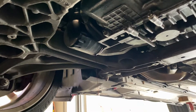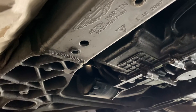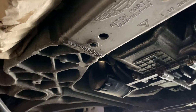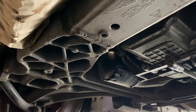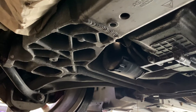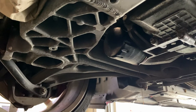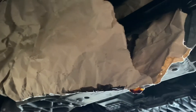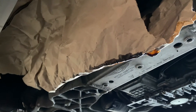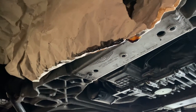Once you have the rear metal plate removed and lowered out of the way, you get access to the oil filter. At this point you can get in to the oil filter with a grabbing tool. I've got three different oil filter removal sockets and none of them fit this one, but this one does. Removing the Aston Martin filter now. I've got a little paper bag to stop me getting dripped on, since it's covering the front oil drain plug underneath the sump — that might be a useful trick.